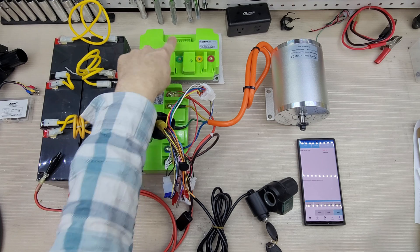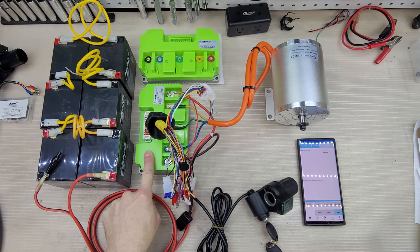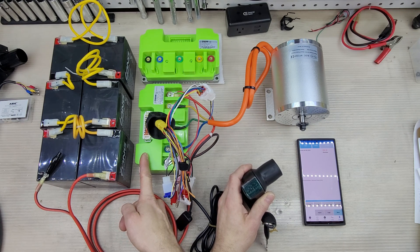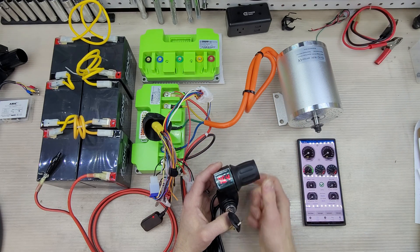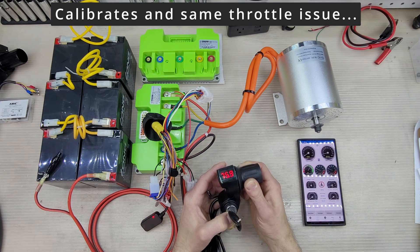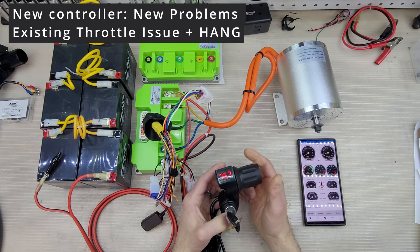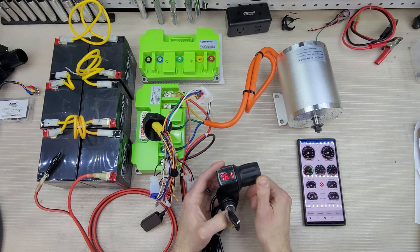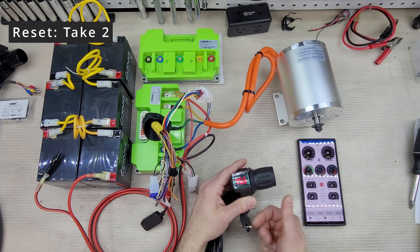In my final test I used only new kit components with my new power supply. Previously I had not used the new controller because the throttle hangs when you get off the throttle. The brand new Far Driver controller kitted with the 3,000 watt motor, packaged and sold by Conray — and guess what, it didn't work. If that motor had stopped I could have revved it again and it could have been full throttle without an issue, but it doesn't stop on this controller.